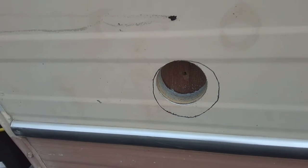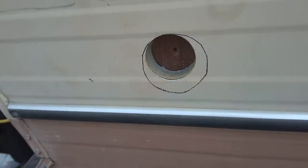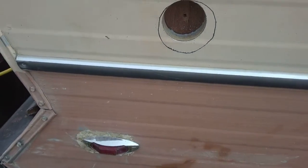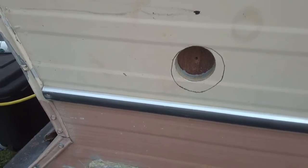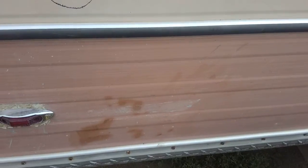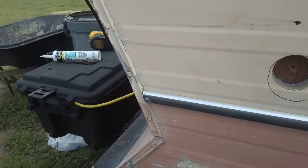If you've ever seen the wall of one of these newer RVs, you've got aluminum, a little piece of paneling which is actually thinner than what I still have to cut through, and then maybe a quarter inch of foam. This is easily a half, if not three-quarter inches, of plywood right across the entire side. Triple layered on the roof. This is a 1971 — all this stuff was cheap, so they didn't really have any reason to skimp. There's also something to be said for having a brand new engine with better gas mileage, though even newer motorhomes aren't getting great mileage. I like solid construction and this definitely qualifies — except it's a pain when you've got to cut through it.